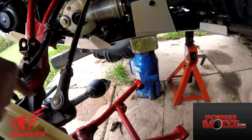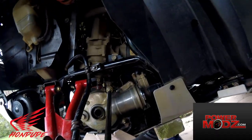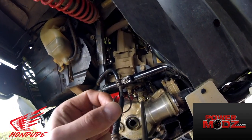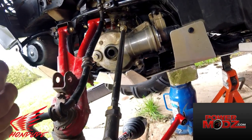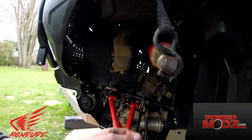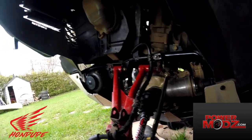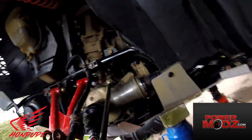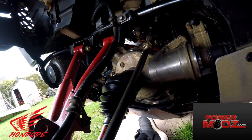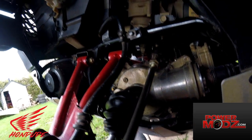I've been fighting to get this axle in here into the diff. I pulled it out and looked inside — the snap ring off the old axle got stuck inside my diff, and that is why I could not get this axle in. First time that's ever happened to me, so I guess keep an eye on that. Once I cleared it, it popped in right away. It's funny how things work when they should. So if you're running into issues, stop trying to force it — there's probably something wrong. Use your brain, unlike me, and inspect it.